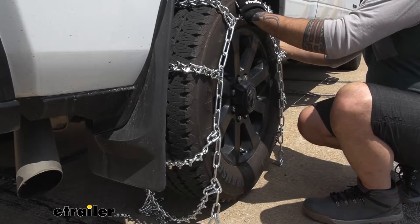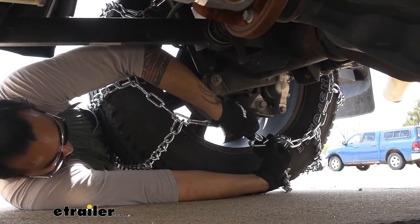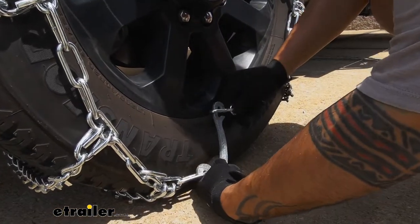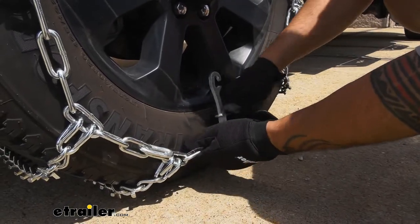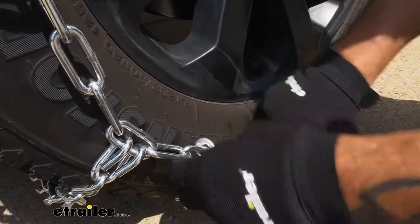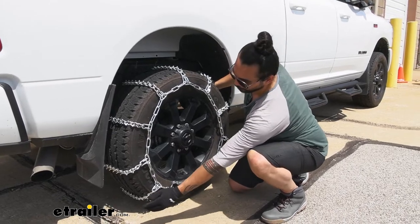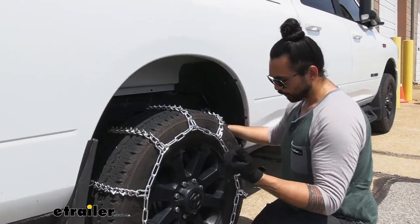Then I'm going to meet you in the back for our first connection. So we have our hook and our link here — this fits nicely on just the first link for this tire. Then we're going to do the same thing on the other side and come around, loop it through and connect it to this free hanging link. Once we have everything connected, we're going to double check to make sure that the V's on the chain links are sticking away from our tire.